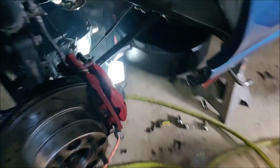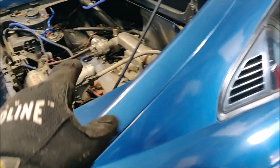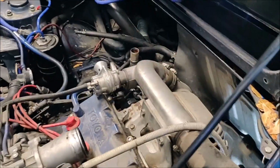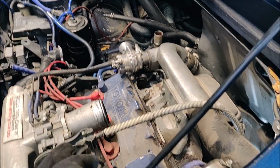So Jaden's in the process of doing that. I just got this all welded up. It's all just tacked around because it's too thin to do beads. But it'll be perfectly fine. So we're gonna vacuum that out, blow some paint on it, put this back together. And then it's oil pan. I'm probably going to start up here on radiator hoses, boost piping, etc. And we'll throw that back together. At this rate, we should all be good.